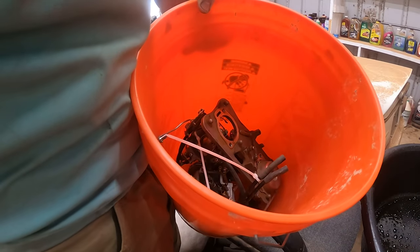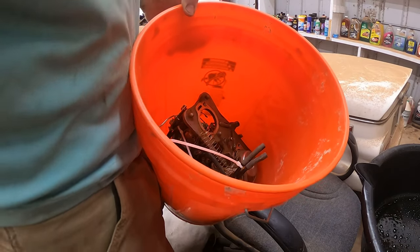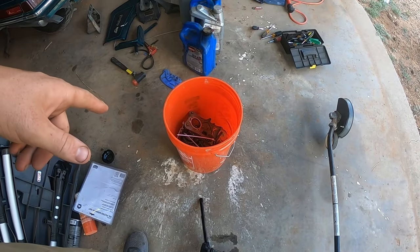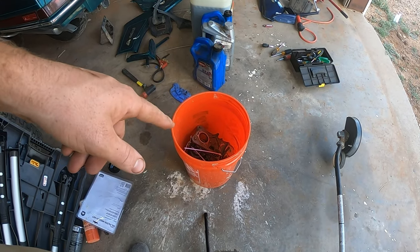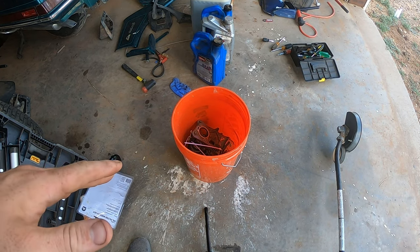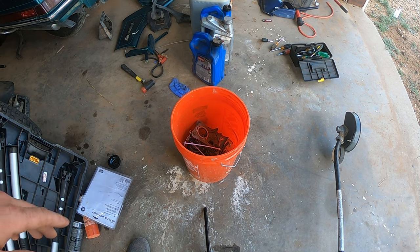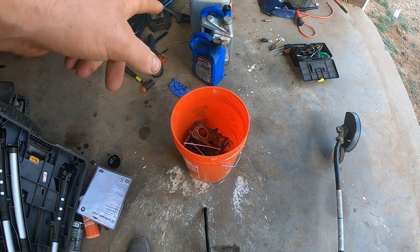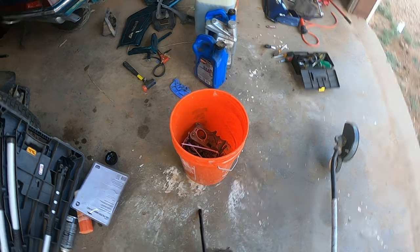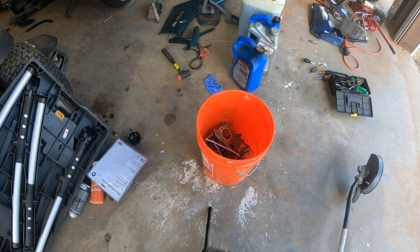New gasoline works fine for soaking but puts off more vapors, so old gasoline works well as a solvent — it'll dissolve all the dirt, grease, and grime. We already pulled old gas from the motorcycle's fuel tank since it had been sitting a while. Instead of throwing it away, you can use it as a makeshift parts washer. We're going to soak everything in there for 24 hours to cut through the dirt and grime, making it easy to clean in the next episode.